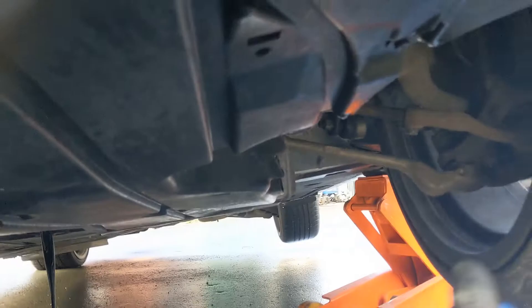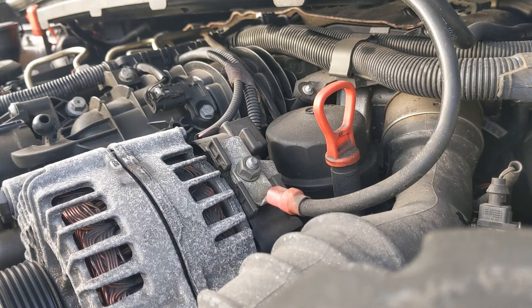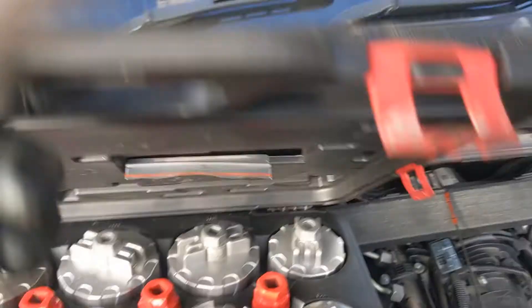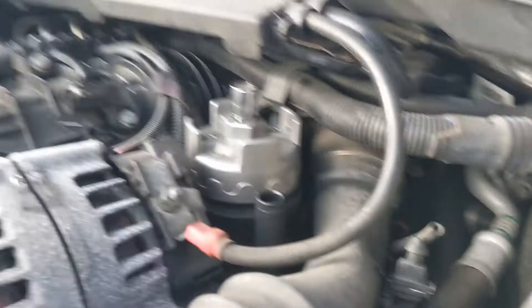The filter is just next to the dipstick. I'll pop this engine cover off and it should be right there. Let's get the appropriate tool — what we're using is this sort of filter cap set, Generation 2 oil filter set. You can use water pump pliers or adjustable pliers, but it's hard work getting in there and there is also the chance you might crack that filter housing. So we'll just go with this.